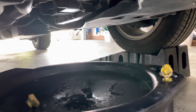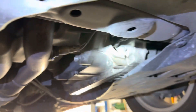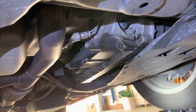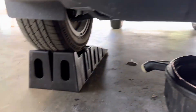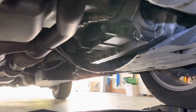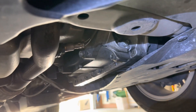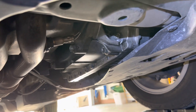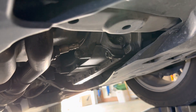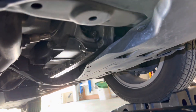The transmission drain plug is located right here under the vehicle — that's what the 3/8 drive is for. A little tip: I've got the vehicle up on ramps for extra clearance and I put my drain pan on a box so it sits up closer to the drain plug. This fluid is really thin and rushes out fast, so I wear a glove and hold the drain plug just off the hole to slow the fluid down and make a lot less of a mess.